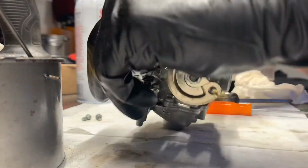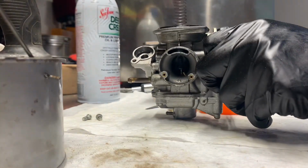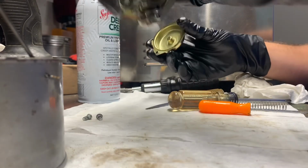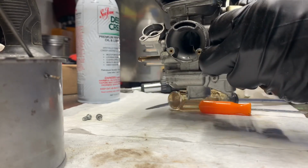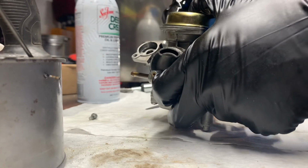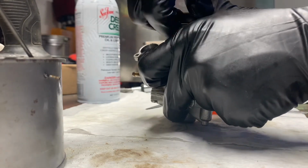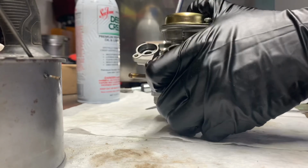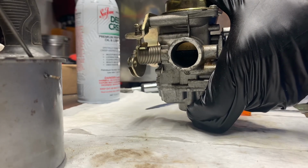We want to put our spring in next, so the spring will go in like so. I'm going to put our cap on. Just had a little excess seafoam spray left on there. I want it on there, I just don't want too much. All right, and now let's put these last 2 screws and we'll have a reassembled carburetor, and it'll be time to look at that air filter. Just get these both in there and then go back and forth and snug them in appropriately.